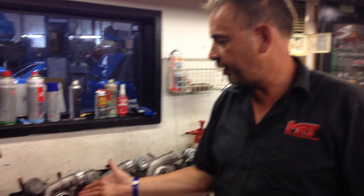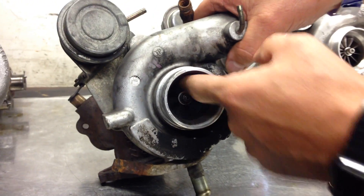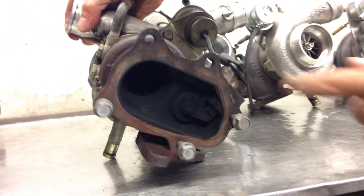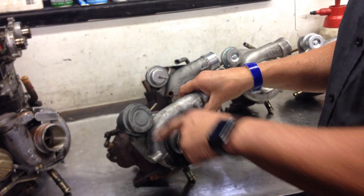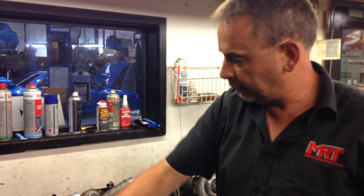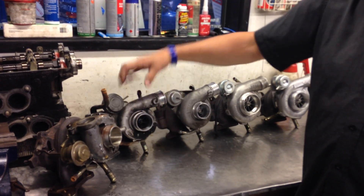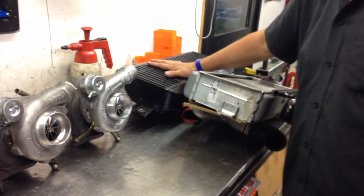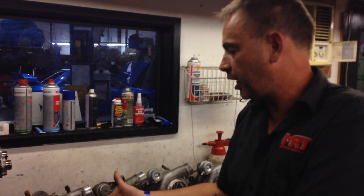Back in 1994 when we had the very first WRX developed in Japan - the basis of the Legacy which then became the Subaru RS in Australia - we have the TD04, which is a very common turbo. You can see the compressor housing on this side and then the exhaust housing on this side, the wastegate which is integral in the exhaust housing actuated by the arm, controlled by the wastegate boost control solenoid and the factory ECU. The inlet comes under the inlet manifold.